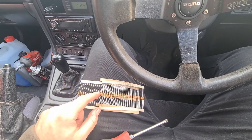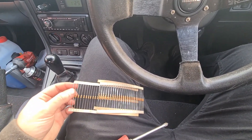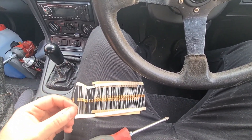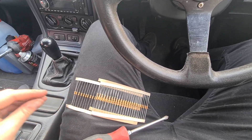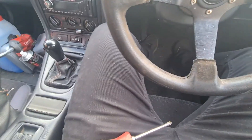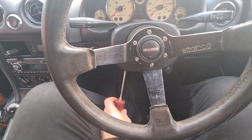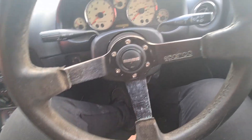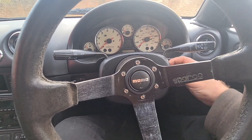If you need to know where to get these resistors, I'll leave a link in the description below. I'm not sure if it's going to work, but I have read somewhere that if you put a small resistor and loop it, it should make the airbag light go out. You will need something to cut them down because they're a bit long. Then you will need to take your Phillips screwdriver and remove the two screws — one here and one there. Once you have the screws removed, you should be able to unclip the shroud.